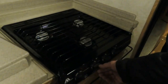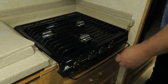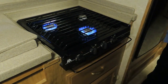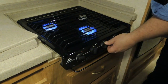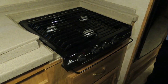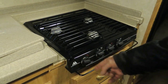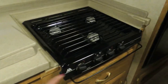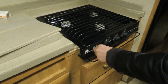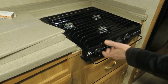The front burner, marked in red, is a high-output burner. See how high that one burns? This one will allow you to boil water where the other two won't — the other two don't get hot enough. Always turn it in the direction of the spark. This is just the spark knob; you turn on your gas and then turn it in the spark direction. You never turn it back the other way — you'll break it. Then you turn it off.